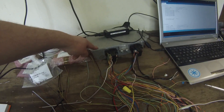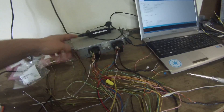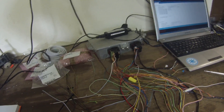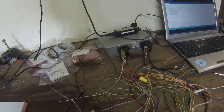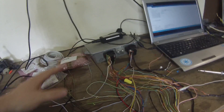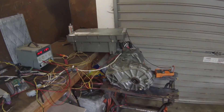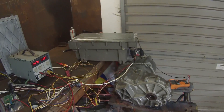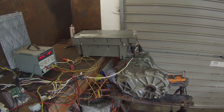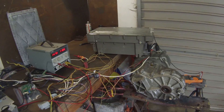This is what they call the VMU or the ECU. This is what takes in all the signals from the car — signals from BMS, ABS, throttle pedal, gear lever, all that — and decides what CAN messages to send down to the inverter that tells it how much torque we need, in what direction, and whether it's traction torque or regen torque.